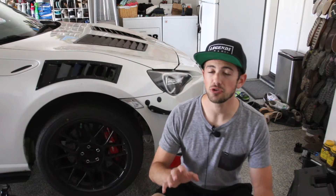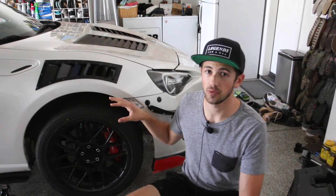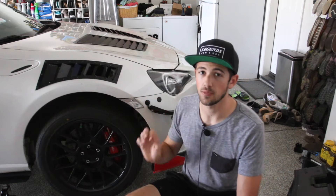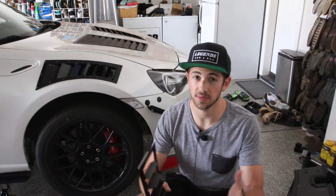In addition, if you remove the fender liner in entirety, there's air traveling through your grill and through your radiator that can now travel through these fender vents, making your cooling capacity more efficient. And lastly, these fender vents also increase front downforce, which is always a plus.